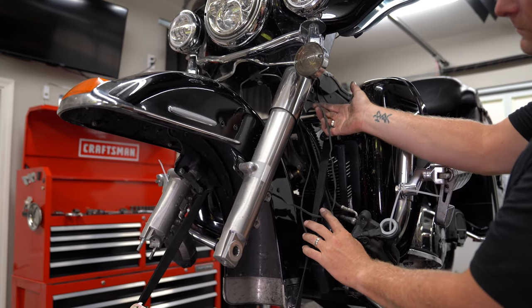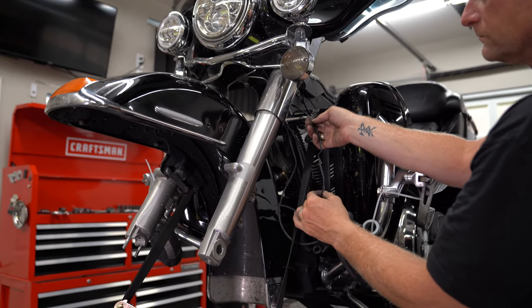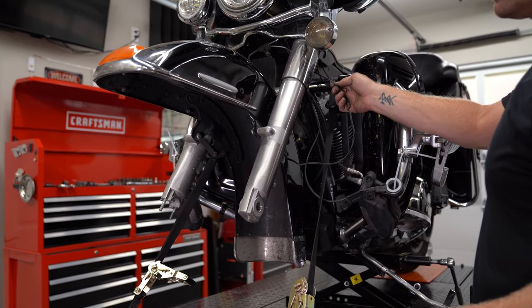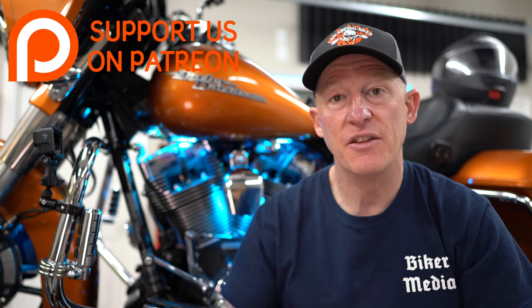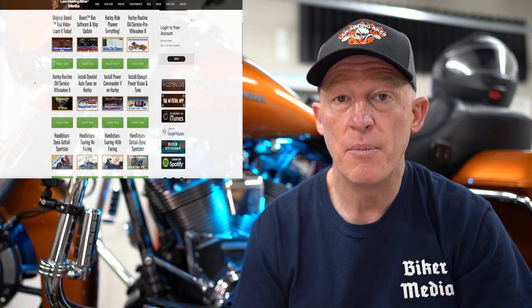This one wire Oscar has for this ultra limited actually runs that front light up on your fender. You could go up in your fairing and find the plug and unplug it, but it looks like we have enough slack — we're not going to have to take the extra time to do that. We'll unbolt the fender and should just be able to lay it down on the lift without having to unplug it. Quick note: a ton of man hours, effort, and expenses go into helping as many bikers as we can worldwide. There's a way you can support us and get benefits — you can become a patron member. Link in the description below. You pledge a certain amount per piece of content with no risk because you can put a monthly cap. Benefits include t-shirt stickers, the private Facebook group, access to live private video broadcasts and chat, premium videos upon request, and access to ride events and meetups.